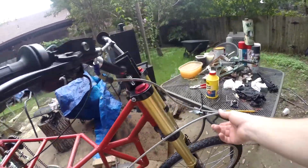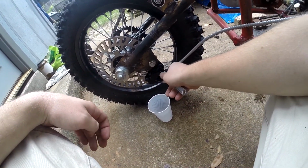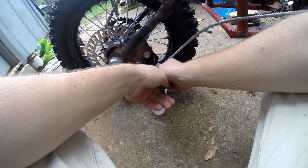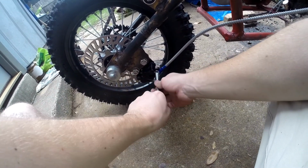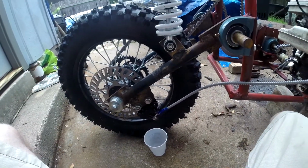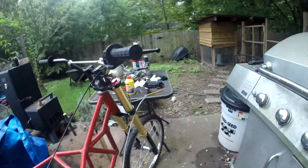Okay, now that I've got a cup and got this all kind of level, we can go ahead and start. I've got the bleeder screw, which hopefully you can see. Here, I'll be loosening that thing up. Just a little bit, because I don't know how much it takes. It doesn't take much, I know that. And I'll leave it about like that, so I can hopefully catch the drops. I'll start adding fluid.